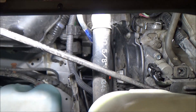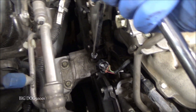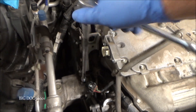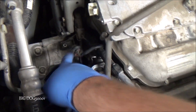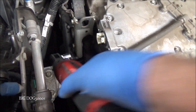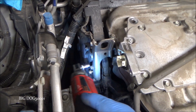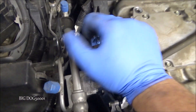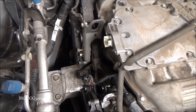I just dropped a 10mm socket all the way down there — it's gone. Now that I can't find my 10mm, here's another 10mm socket. We'll just go ahead and crack that loose and pop it out — try not to lose that. With that bolt removed, you can see our harness is still kind of pinned in there, so we're going to pull this bracket off — two 12mm bolts right here. I'm going to put my hand down there so I don't drop those bolts.